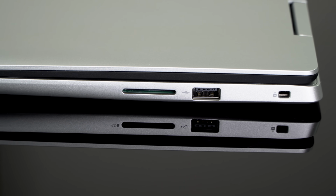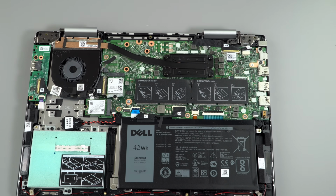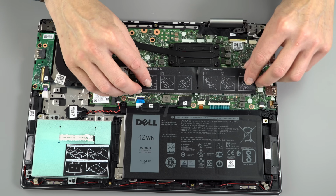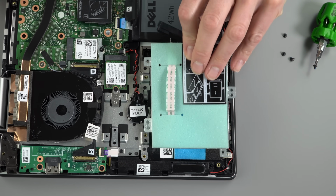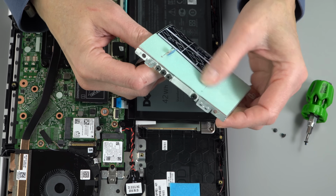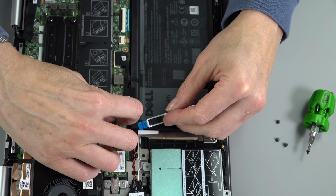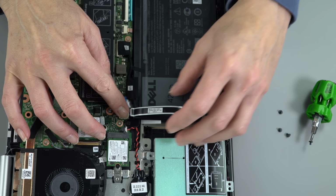So that's good there. Another thing that having not the skinniest chassis in the world brings us is when you take the bottom off, which isn't too hard, unlike HP, who makes it kind of hard with their consumer laptops, you unscrew the Phillips head screws on the bottom, and we'll show you that inside. But what you've got is a 2.5-inch hard drive bay and an M.2 SSD slot inside, and 2 RAM slots as well. So if you buy the 8 gig model, which is what we have, it's 8 gigs of RAM, the 256 gig SSD, you can just buy another 8 gig module, which isn't as painfully expensive, and throw that in there. You're up to 16 gigs just like that, or you could go for broke and go for 32 gigs. Something I like about the Inspiron models, they're kind of designed for the tinkerers out there who might want to upgrade after the fact.